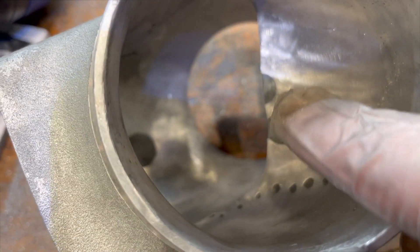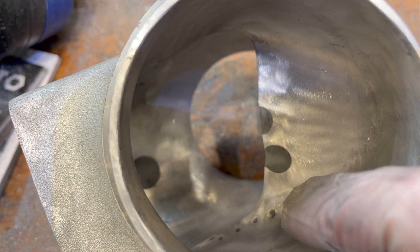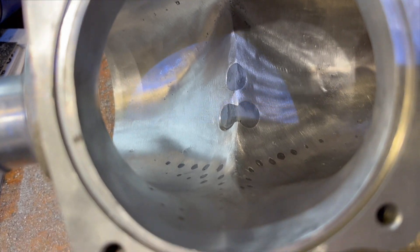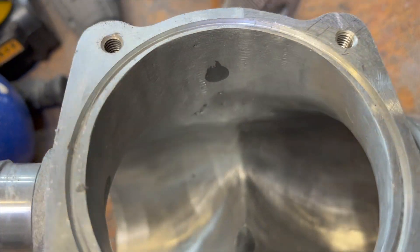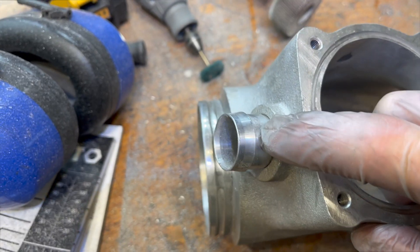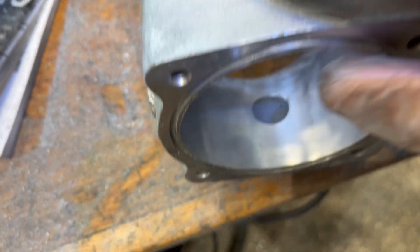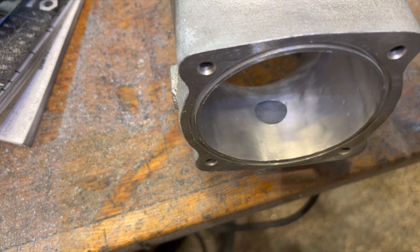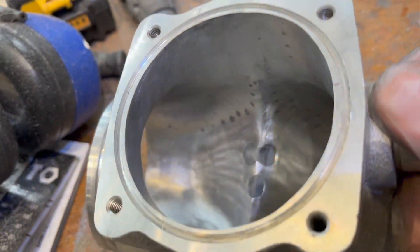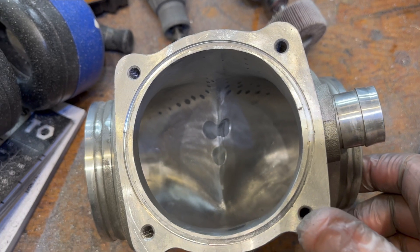There was also a hole going through the center — we filled that in with epoxy as well. Those appear to be manufacturing holes that provided no benefit to airflow. On the intake side, you can see where we cleaned up the splitter and almost all of the speed bumps are gone. We also plugged up the AOS (air oil separator) port with epoxy for a smooth finish, and even small things like the little access nipple were filled up, so air flowing through these ports is as smooth and efficient as possible.